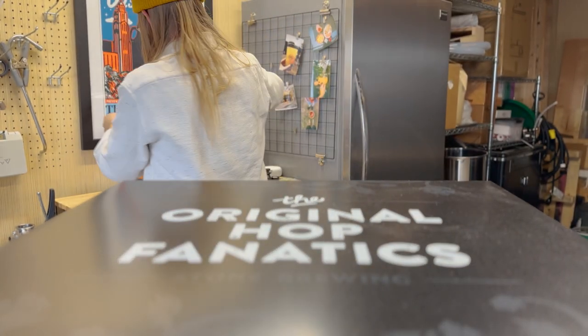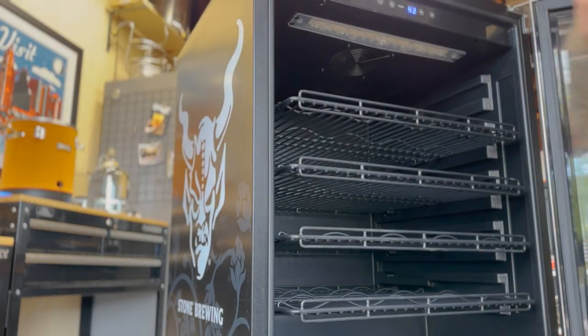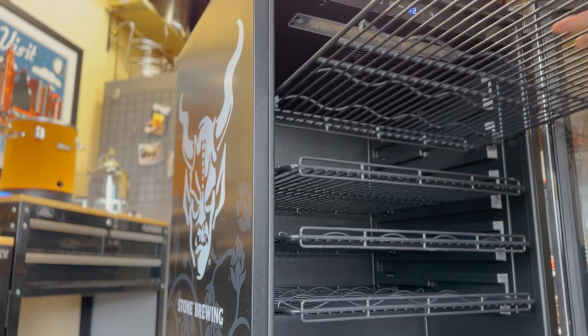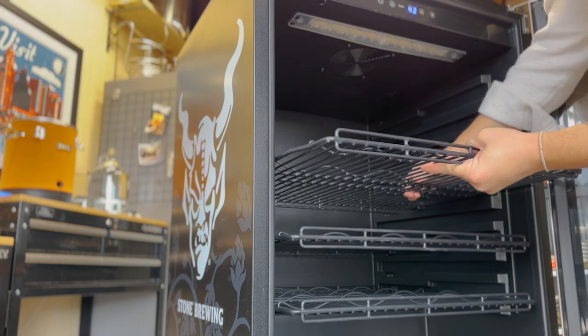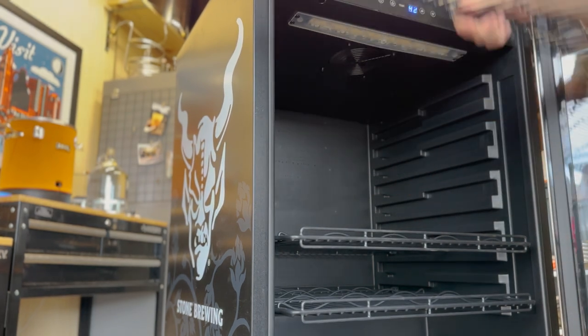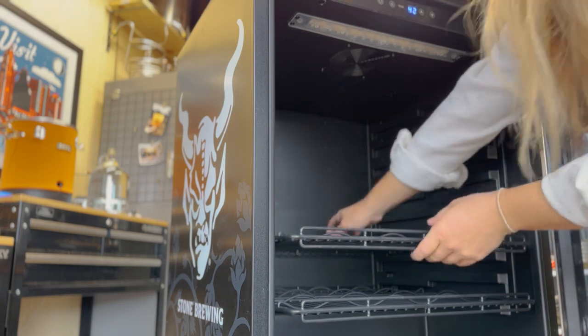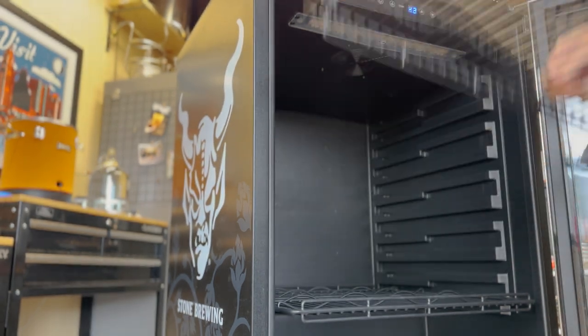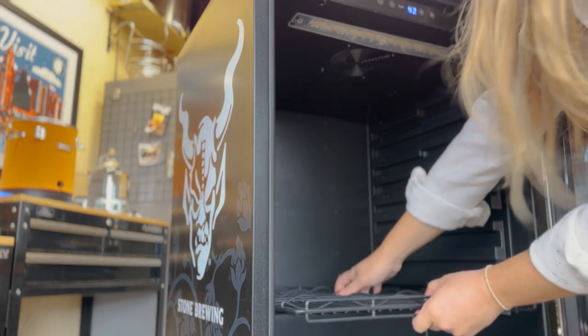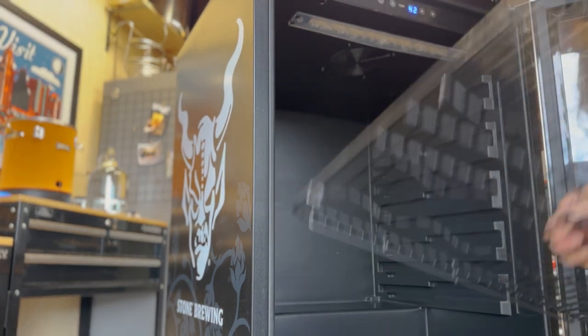Once you've sourced all the parts, it's time to assemble your fermentation chamber. Start by preparing your refrigerator. You'll need to remove all the shelves and anything else from inside the refrigerator. If yours has a freezer shelf, you may be able to mount it vertically in the back of the refrigerator, but be careful not to bend it and definitely don't fully disconnect it.